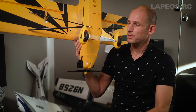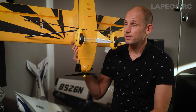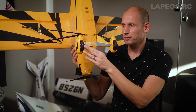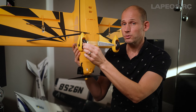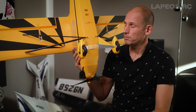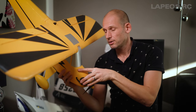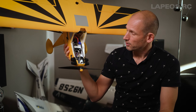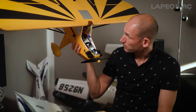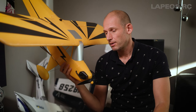By having a wire like this, if I get a hit, it just turns one way or the other. It's not a perfect solution but it does actually work. The downside is on rougher landings the plane can be a little bit tilted on the ground, but it doesn't matter because it runs fine anyway. I put rubber wheels on this one which are a little bit smaller but much softer, so they will absorb some bouncing. This RC airplane is truly great flying and features a nice hatch with great interior space, just like on the Turbo Timber Evolution. The fuselage is reinforced with carbon fiber rods going back into the fuselage.